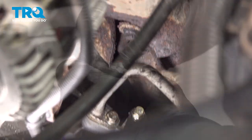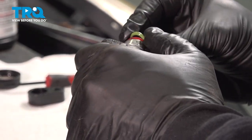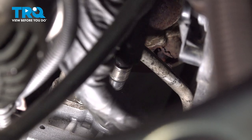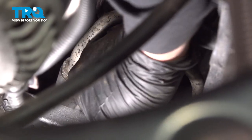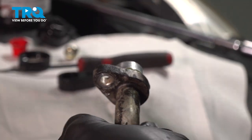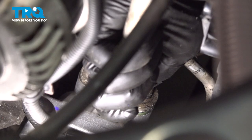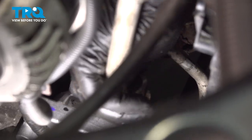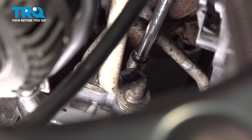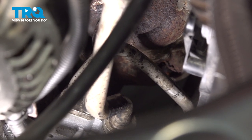Let's go ahead and repeat for the other line. Remove that O-ring, get the new O-ring installed, and coat it in some fresh PAG oil. Remove the plug, line that up, drop it down carefully and press it in. Once we get that lined up, go ahead and get that bolt threaded down. Once that's seated, snug it down — you'll feel the bolt bottom out, then a quarter turn. Both bolts are bottomed out with a quarter turn.